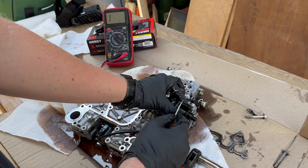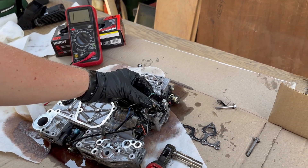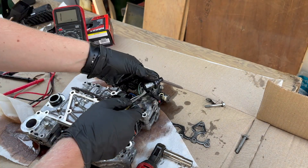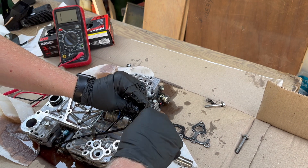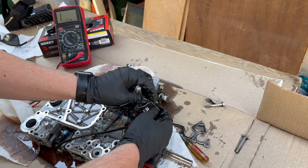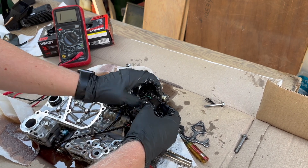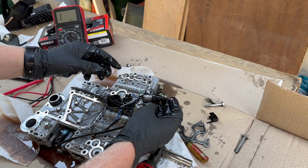Take these wires off here. You might be tempted to take off this top cap, but it does not have to come off. You can stick a little fine screwdriver right here and slowly lift it up. You've got to be careful because it will grab the wires and pull them, so you just have to pop them free of the back. There we go — and it just pulls off just like that. One solenoid out.